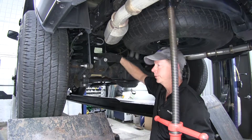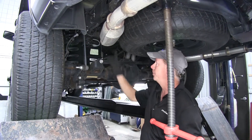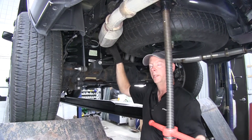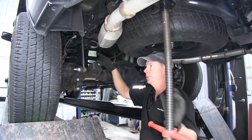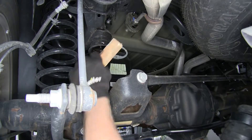Getting our truck prepared, we need to actually raise the truck up a little bit off the suspension so the axle will hang down and the body and frame go up. I use the floor jack, but you can use anything you want to help lift it up as long as it's safe. To help us install the spring, I'm going to use a piece of 2x4.